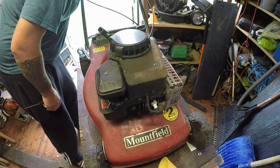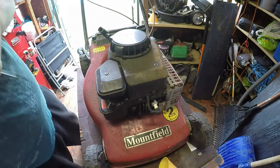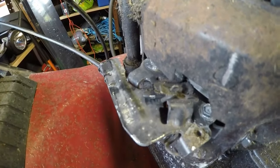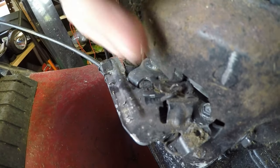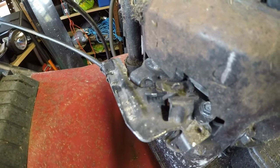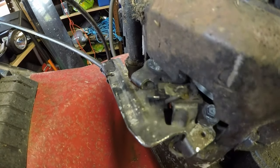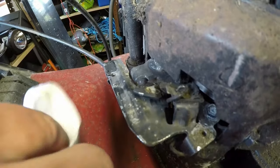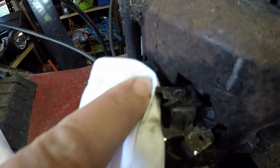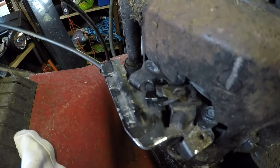The actual switch is working, but there's a bit of grease around it. So the first thing we're looking at is this micro switch, and there's a big bit of grease right on the end of it. The first thing I want to do is just clean that off. Because number one, we shouldn't be able to start this lawnmower up with the dead man's handle in. I'm going to literally just clean this area so it makes a good contact.